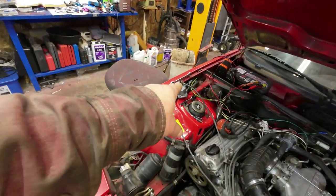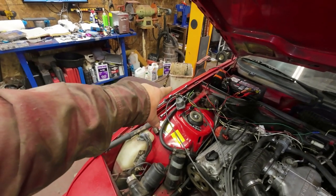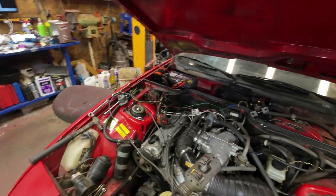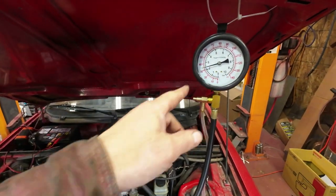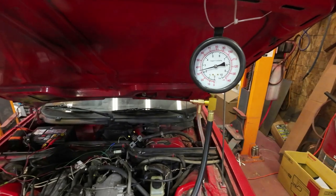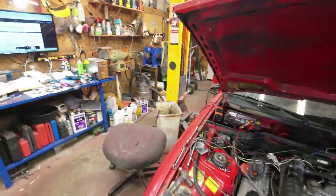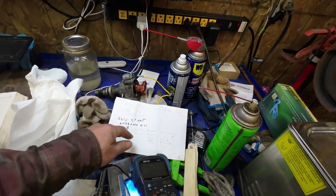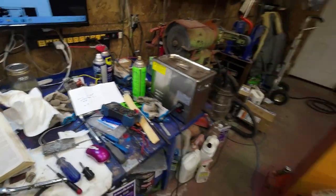I was into that, and I blew some air through it, and I think the inside of the mechanism there is constricted, blocking it. So now it's down to 2.5, but right now it should be full open. It should be at 1.5 or something like that when it's full open like that. Let me just let it run for a few minutes and I'll check my numbers here. Yeah, cold is 1 to 1.5 and hot is 3.4 to 3.8.